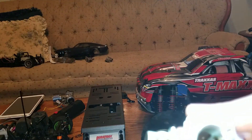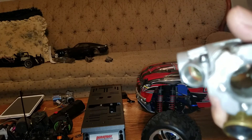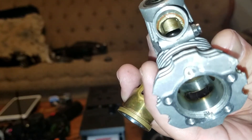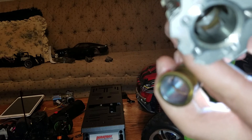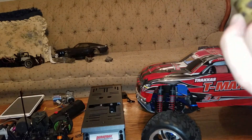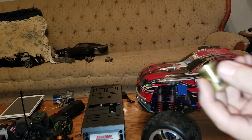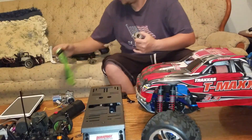Looking inside the motor you can see there are grooves. You have one at the back — that's your exhaust port — then another groove, and another at the front which is known as the boost port. All along this you have holes. This is the exhaust port; this is the boost port. The boost port is what helps get a lot of new air and fuel in, and get the old air and fuel out.